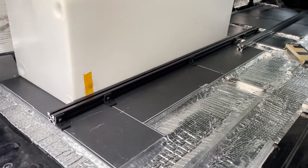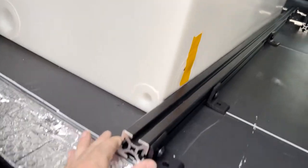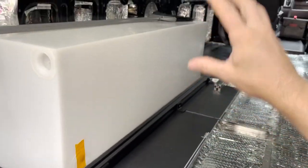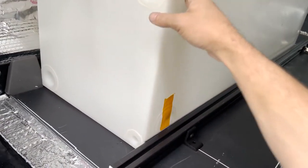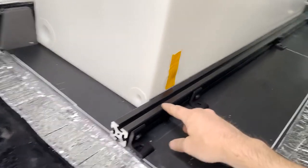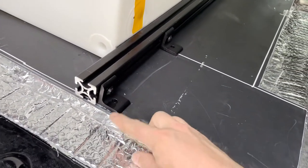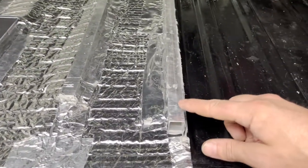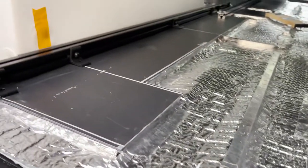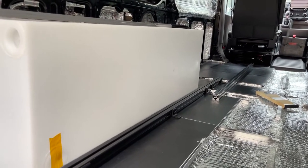After a long wait I finally got my 80-20 aluminum beams in. The very first thing I'm doing is putting in a 6-foot 15-15 series aluminum beam down on the floor. It's going to serve two purposes: it's going to be a mounting brace for all the furniture and the bed on top, and it's also going to wedge the water tank in place so I don't have to glue it and can remove it later. I put a little quarter-inch sheet of rubber, spray-adhesived it to one side of the aluminum, and now I'm going to drill pilot holes into the aluminum tube stock which I use as a floor joist, install a rivnut in it, and bolt directly into it. It's my first time using the riveting tool but I did a test run on a throwaway piece of aluminum and it worked great, so I'm kind of excited about it.